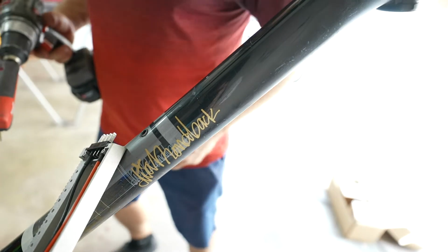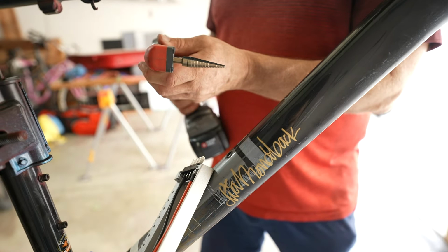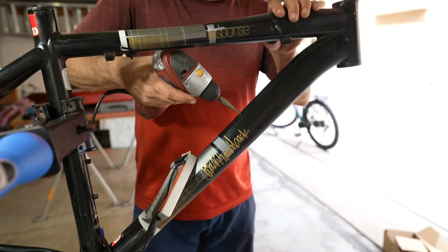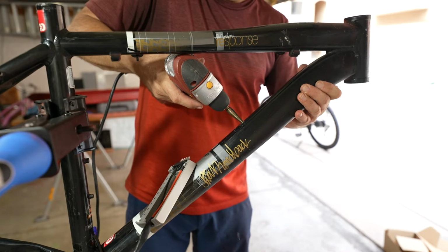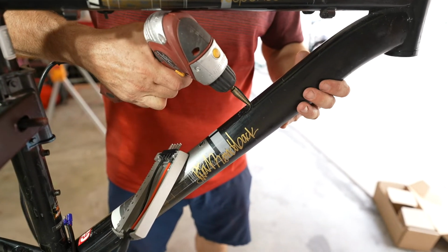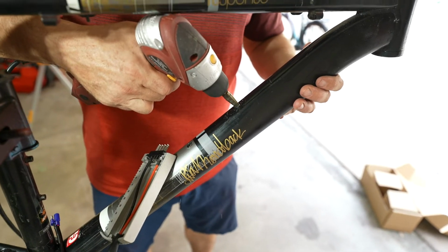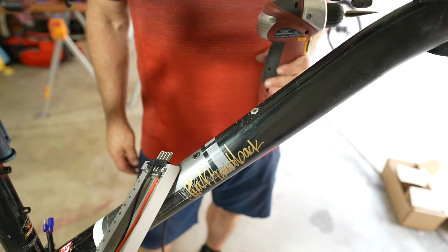There, got our pilot hole. So now we're going to use basically just a drill bit for making variable sized holes in sheet metal, in 1/32 increments. I have a small drill that I can... So what I do is I just sneak up on it, one step at a time. I think one more. Yep. One more step. We ought to... There we go. Perfect. So then our riv nut should fit down inside there perfectly.